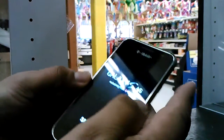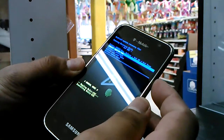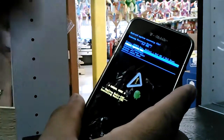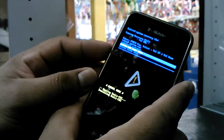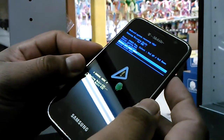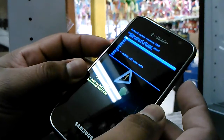If this happened, just press the power button. You'll see the menu appears. We're gonna start using the volume down to select the third option, which is 'delete all user data,' with the volume down key. Now press the power button to select that — to enter or execute the action.